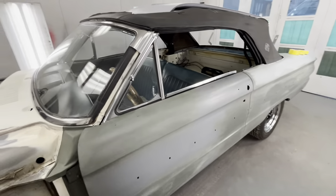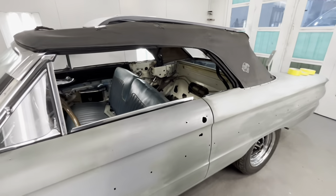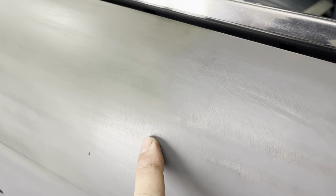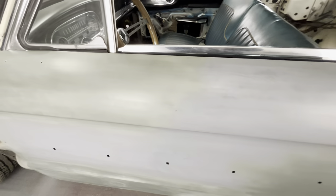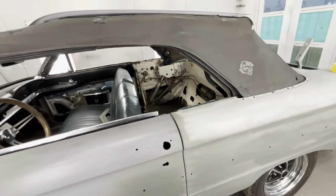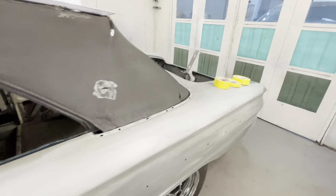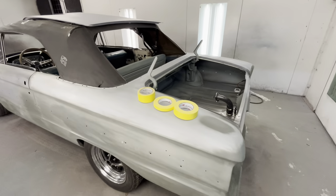He's coming in here and all your green primer is normally etching primer. There are some mixtures of gray primers in here and I'm hoping none of this stuff lifts — that's the chance you take. You can see a lot of grinding marks in here, so this really needed a 2K primer to go over it to get rid of all this. It's slick and smooth because he wet sanded everything, but this is the level he's brought it to. I've been hired to paint, not to do body work.